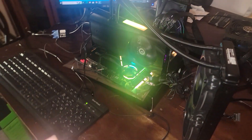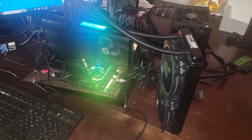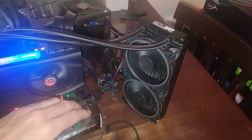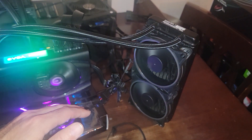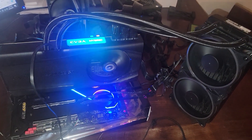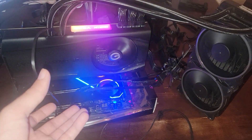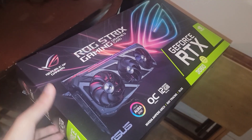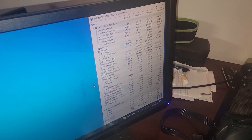We need to dig into this connector and the hybrid cooling setup, and go ahead and replace the thermal pads — we'll do that in a future video. Most importantly, just clean your fans every once in a while. Use a toothbrush with soft bristles or Q-tips with a little Pledge or electronics-safe alcohol on a paper towel or rag — clean your blades, improve airflow, and get your cards running a lot better. Also, we are doing a giveaway of this GPU; links should be in the description. Thermals got really hot, the system shut down, and the pump is not working — needs further investigation.